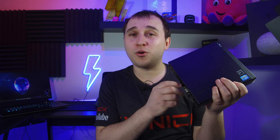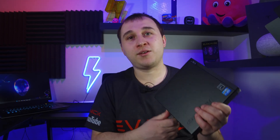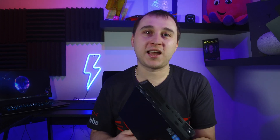You can boot from USB — I think it's F2 on this system. If you're struggling to see the boot-up screen, you can press Enter and that will enter the BIOS. Change the BIOS to prioritise this key as the boot device, or select the USB boot option. Boot from the USB with the SSD already left inside. It will boot up with the Ubuntu live operating system. Select 'Try' — don't install it, just try it. Once it's initialised, go to a web browser. Make sure you're plugged into the internet or that it has a Wi-Fi chip, connect to the internet, and follow the Home Assistant installation guide pretty much exactly as you would on your normal computer.